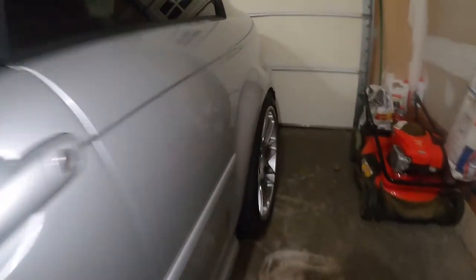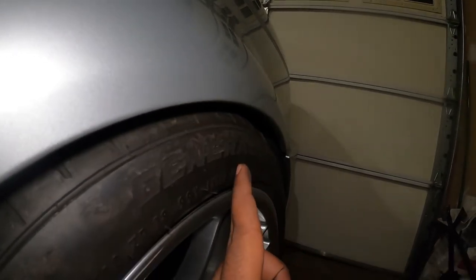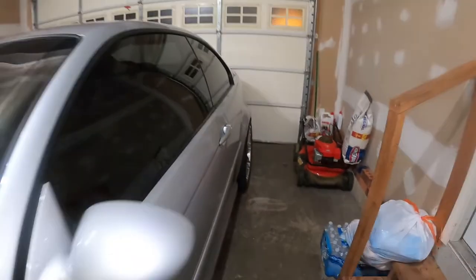For now it is looking much much better than before. On the back I have 12 millimeters and it is meaty — I love it. The fitment is so good. With my current tire setup, 15 millimeters all around would probably give me exactly what I'm looking for, but since I don't have the fender rolled I'm afraid pushing too much might cause rubbing on big dips. I drove around a bit and it's perfectly fine, so I'm going to leave it as is.